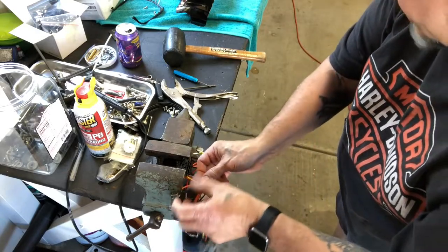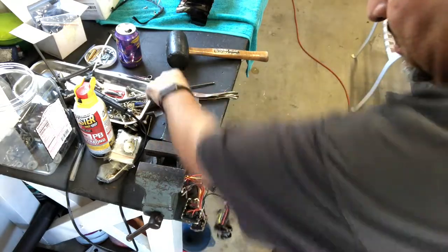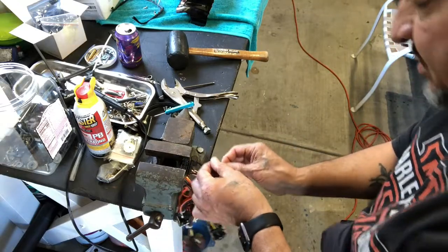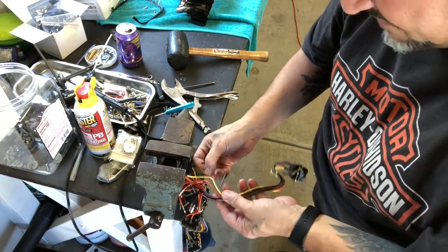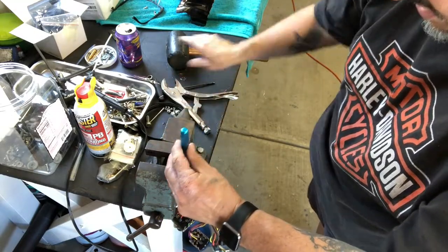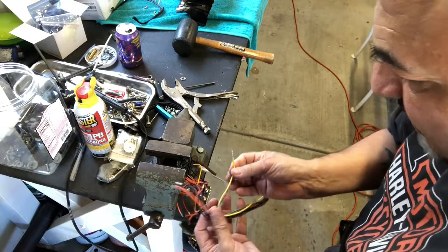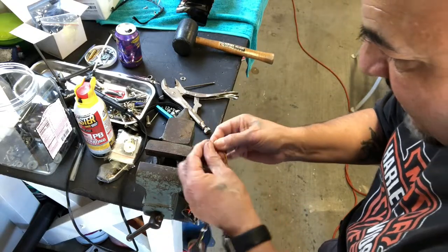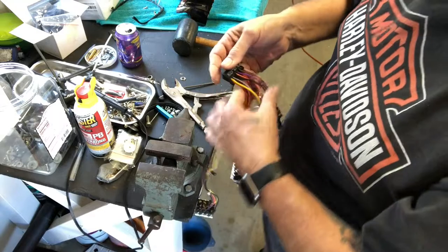So now this is the old one — we have the gray and the yellow. I'm going to get on the gray: stick it inside the pin itself and tap. There's the gray one — gray with a black stripe. Here's the gray on the new one. Going to make sure it's facing in, get that baby inside of there, and there it is — it snapped in. The last one we have from this is the yellow. Get this pin, put it in there, tap. Snapped it out. Here's the yellow one — that was actually the last one. This yellow is kind of faded, doesn't have a marker. This is the only yellow coming from the long one. Make sure that groove is facing in, get that baby in there, and let it snap.